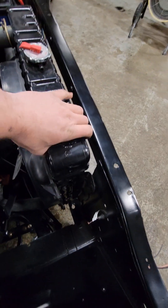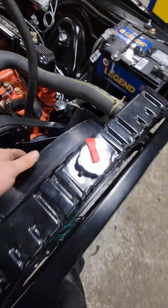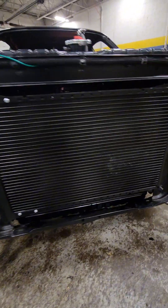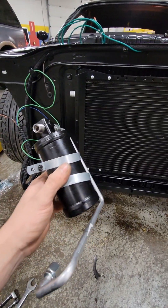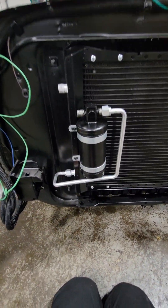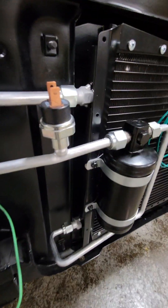The instructions give you points to where to drill holes into the firewall to mount the air box easily. We also drill a hole into the firewall to route the drain tube out under the car. Some assembly for the condenser is required — we mount the brackets to it and remove the radiator from the core support to slide the condenser in between the two. I could not fit the dryer in between, but luckily I don't have the front fenders in the car, so I just took the dryer off, slapped everything onto the front, and remounted the dryer.